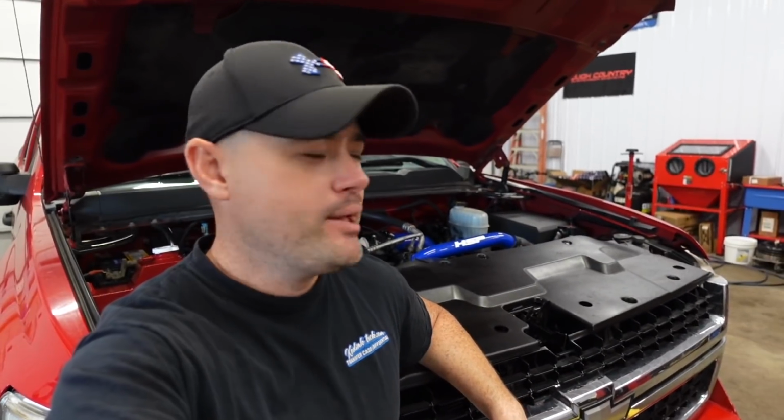I still haven't done a vane position relearn on this brand new RDS turbo. So that actually might be our issue. So as far as the boost test goes, that is inconclusive. We're not gonna use those readings. You know what, let me just call the expert right now. I'm gonna call Ryan at Ryan's Diesel Service, and maybe he might be able to give me some better insight on that. Let's do that.